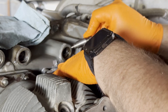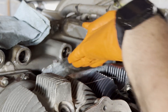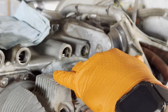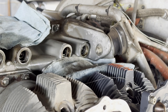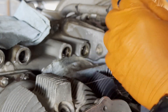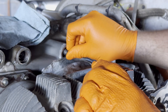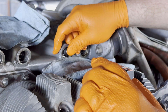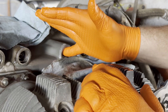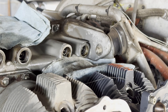Alrighty. We've oiled our valve lash adjuster back up and she goes — gentle push to put it back into place. We've cleaned off the pressing face, make sure that we have the concave surface facing out towards us — that actually comes in contact with the push rod. Get that aligned and gently push it back in. As you push back, you should be able to feel that spring pushing back against you. Now we've got movement. We can put the push rods back in.